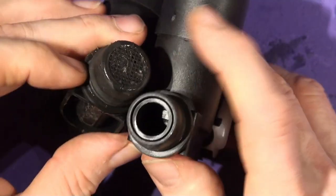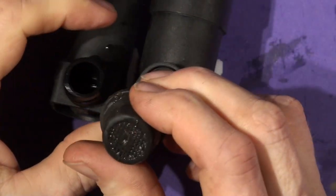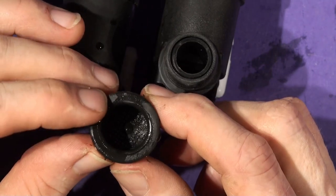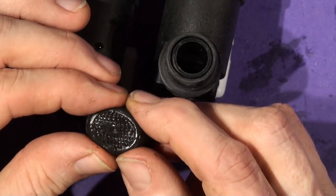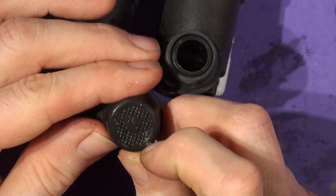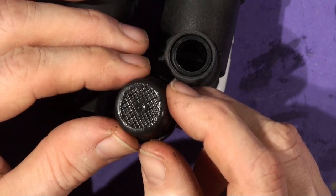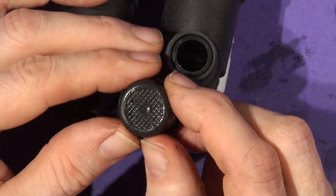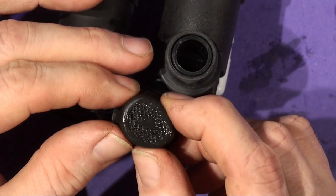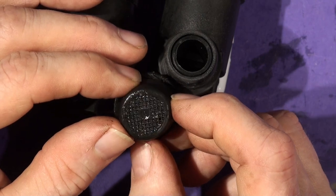The key thing is the rubber on the end. Look, we've got a T-strainer on one end that was kind of filmed up. You have to be careful what you put in your washer tank, don't you? If you put the wrong stuff in, you're looking for trouble. It's a lesson to you to put the proper washer fluid so you can't get any bacterial growth in there, and don't use a watering can, so that your water stays clean.